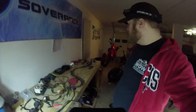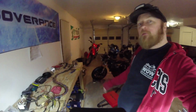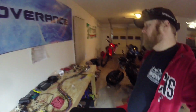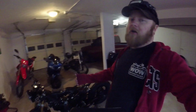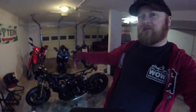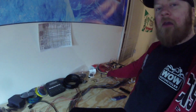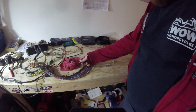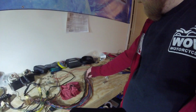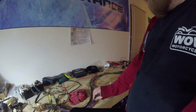Okay, so I actually think we're going to call it there. I'm not going to go ahead and do the other side of the main fuse just yet. We're going to save that for the next video. I decided that mostly because while we used a big thick 10 gauge or 12 gauge wire to get up from the starter solenoid up to the fuse, I don't have anything but 16 gauge wire at the moment, and I think 16 gauge wire is going to work real well for most of the wires in the harness, but the factory Virago main power wire is definitely a 14 gauge, so I think I want to use at least that. So I think I'm going to go order some 14 gauge red wire so that we can make sure that we have a good solid thick main power wire for the harness.